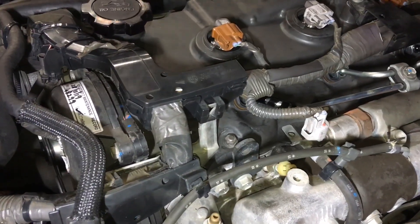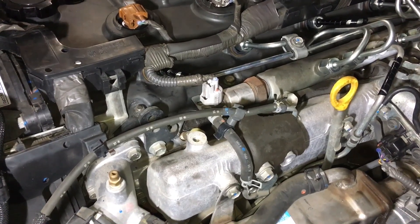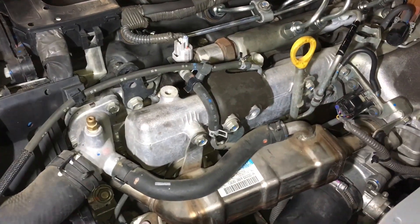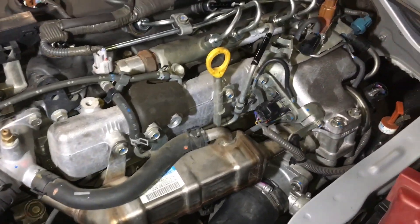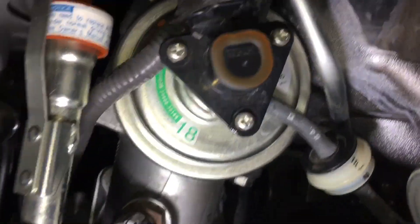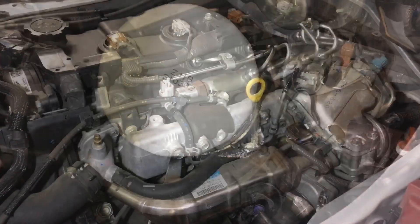There was heaps of that black RTV silicone at the front of the cylinder head at the valve cover — it's just four little dobs. All the EGR valves back on nice and clean, throttle body, intake hoses. When we opened the positive battery terminal, that plastic cover wasn't on so we set it back on — it's there to avoid short circuits. See those fuel line clamps lined up — we do know the valve cover had been off before, which maybe could have caused some contamination to the old injectors. Make sure everything is 100%, double check all your plugs, clips, clamps.